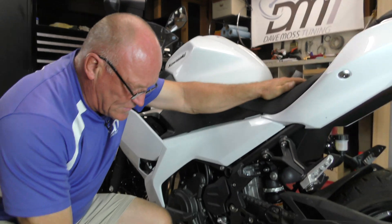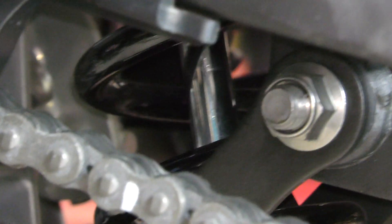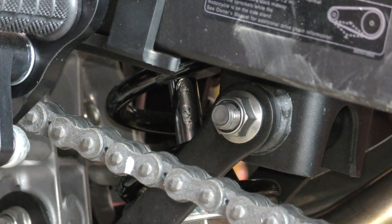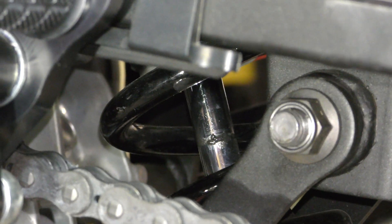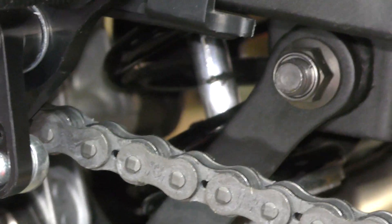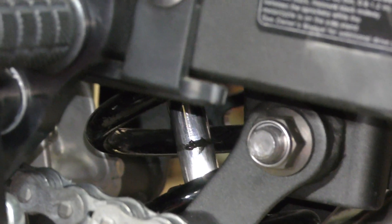All that's left to do now is put a little bit of grease on the shock shaft — that'll tell me how much travel I'm using. Then from the road ride we can assess if the 45-plus millimeter sag is appropriate or if we need to tighten it up. Quick ride done: checking suspension travel — the shock shaft shows we are nowhere near bottom. We set high and low speed at 50 percent of the total range, got the static sag we wanted, and we've got tons of travel left at the bottom of the shaft.